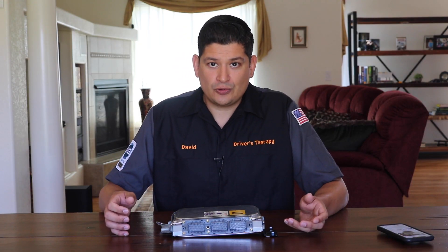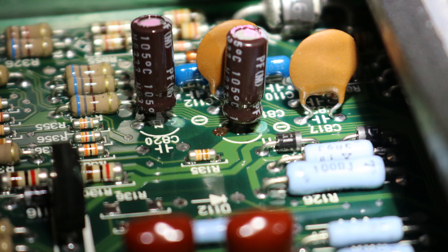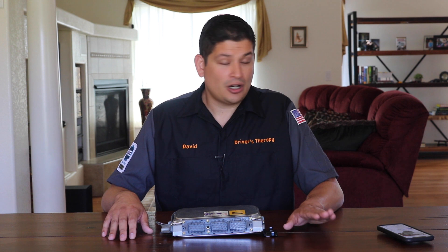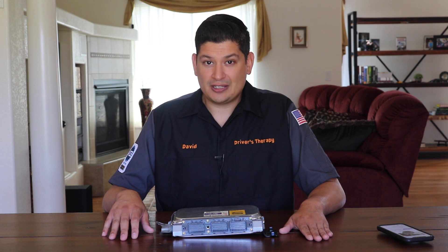Once you pry that open, you're going to look at your board. This is a picture of the capacitors you're going to be looking at — they're brown. You're looking for anything that just looks like rust at the bottom of their legs, where they connect. You're also going to want to look for something that looks like hot glue — either brown or a clearish, murky, glue-looking stuff at the bottom. Essentially, that means the capacitor is leaking. If you're unsure, you could send pictures or talk to somebody like Josh at Relentless Motorsports, or post on the forums. But most likely you'll be able to see if it's leaking.